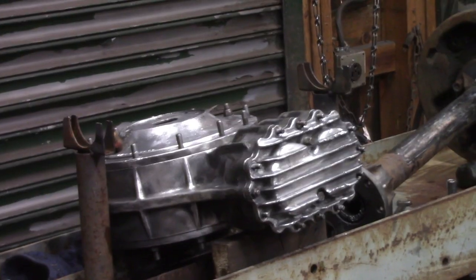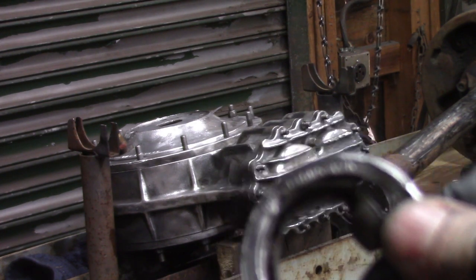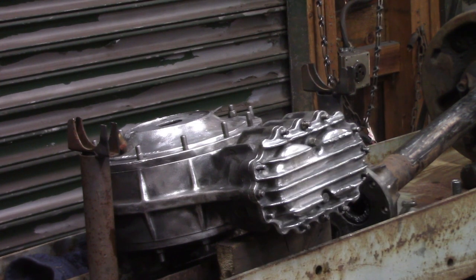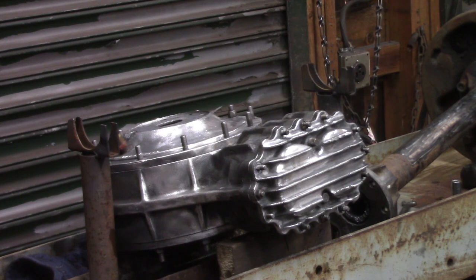So I took it apart, cleaned it out, and I only put a couple of bolts temporarily to put the covers on to keep the dust out, and I need to order the seals for the end caps, the axle seals. I was able to find seals based on the number on the original seal, and the part number is a Chicago Rawhide number, which eventually became CR Seals, and then they were taken over by SKF. Well, SKF has a really good bearing and seal search engine on their website, and I plugged in the number. Sure enough, it came up that it was superseded by another part number, and they're readily available.